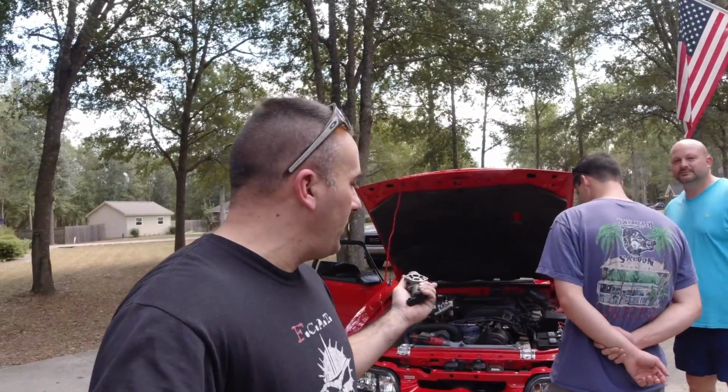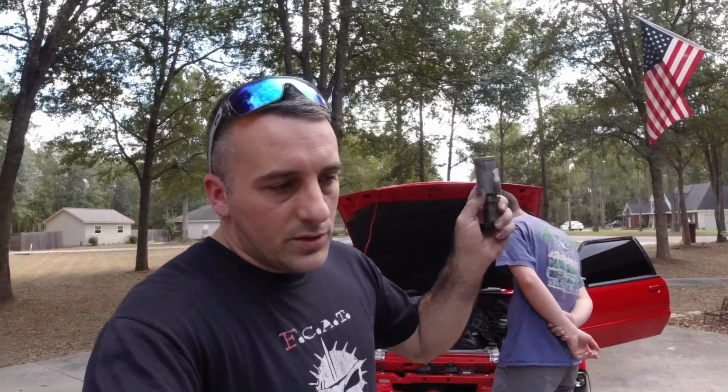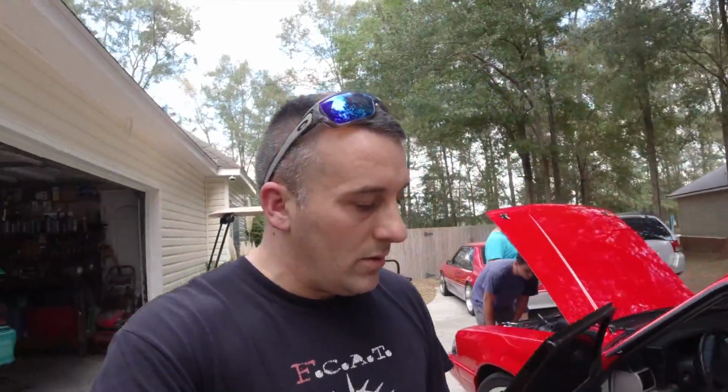Stuff like this, man, it gets me so excited. I love solving a problem like this. This is a crazy thing. After we fixed the wire the first time, we had replaced the idle air control earlier, thinking that was a problem. So once we fixed the wire, this idle air control was bad and wouldn't let the car run, so it seemed like we had not fixed the problem. Either way, the wire needed to be taken out and glued back in, so that's a good thing.